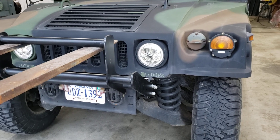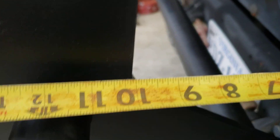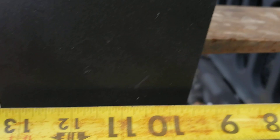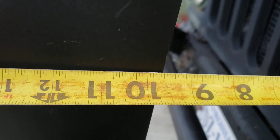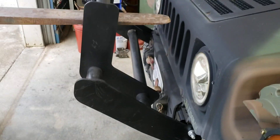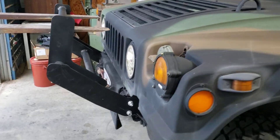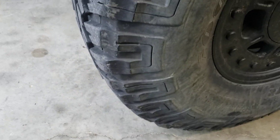I can see the push bar is rotating — it has rotated a little bit inward to start with. Let me find my tape measure. It's about 10 and 5/8 inches away from the truck, so it's tilted to the point that it's almost 10 inches away, and then up here it's about 9 and 5/8. So it is pushing inward, which I'm okay with as a failure mode — I'd rather have that thing absorb a little bit of weight.